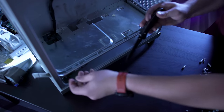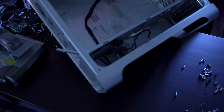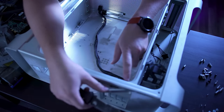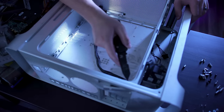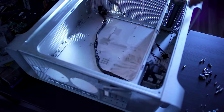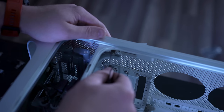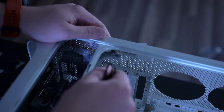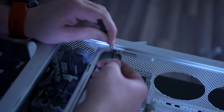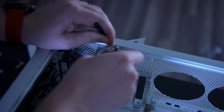There are only three of these latches, so go ahead and keep them - they're not keyed for any specific reinstall order, so it doesn't matter what order they go back on. The last piece of getting this latch mechanism off is actually on the latch itself - there's a little pin right here. You need to pop a little C-clip off of it and then the pin should just drop right out. I'm going to readjust the camera so you can see it. There's this little clip on the latch mechanism - that's the C-clip you need to take off, which is kind of a pain.